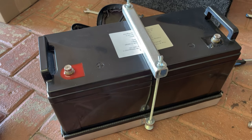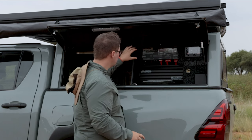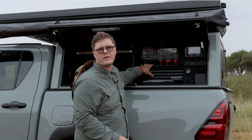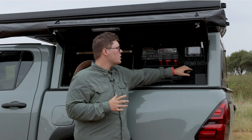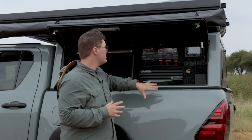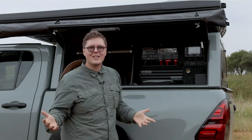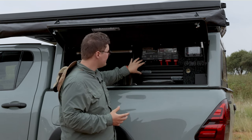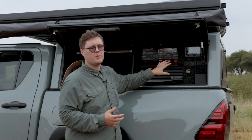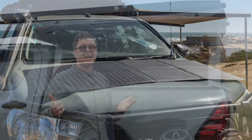I've put in a new 120 amp hour lithium battery, which works wonderfully with this setup. Charging is managed by the Manager 30, which is a 30 amp DC charger with an MPPT and AC charging capability. I've added an AC caravan outlet so I can plug in at a campsite and charge the battery system at 30 amps. You can also charge from solar at 30 amps or from the vehicle battery at 30 amps — hence Manager 30. It's bigger than other DC chargers but it's three units in one. We've got a solar outlet here for when I need to plug in.